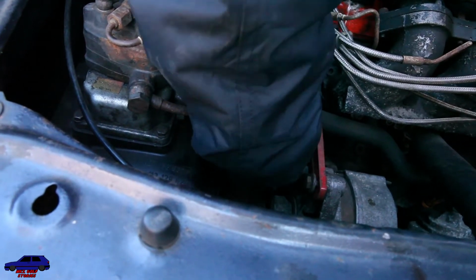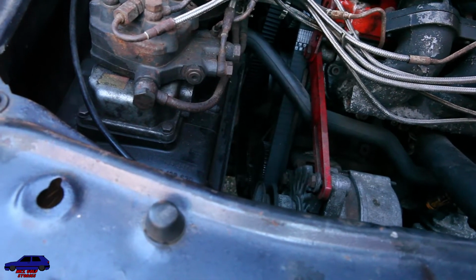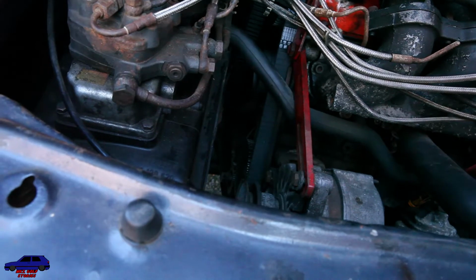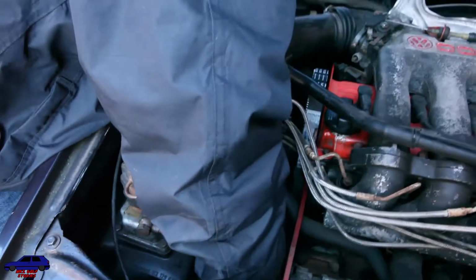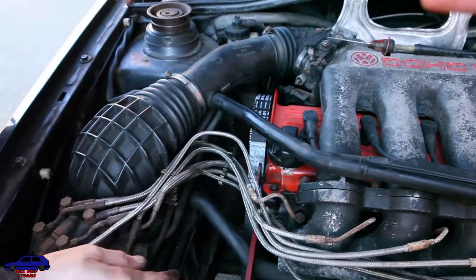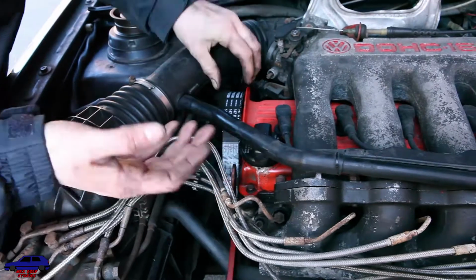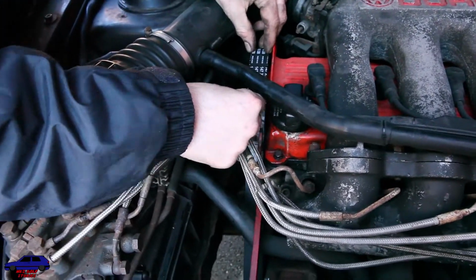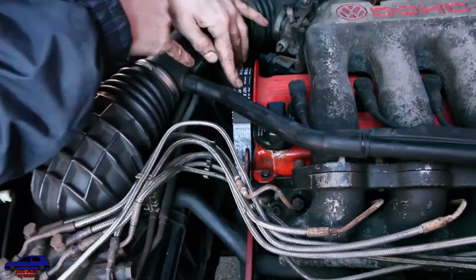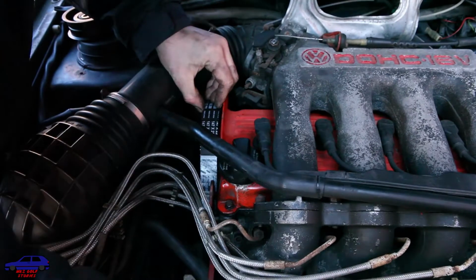Now, it's easier said than done. What we can do is when we've got it tight enough, we can turn it so that the slack then goes onto that side. Not a big issue, really. And should it sit like that with a bit of a gap on some of the teeth showing? Yeah, realistically, it should sit bang in the middle. It's never going to sit bang in the middle because there's always going to be a little bit of movement in them, but realistically you should sit there so you can see that you've got gaps there. Yeah, okay, because I think the other one was too close to the edge, wasn't it?